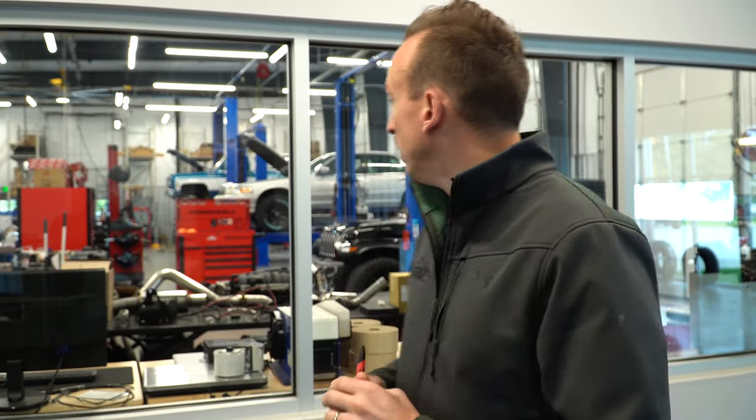So what we're gonna have to unfortunately do is set the upper control arm a little bit shorter than what would be ideal. And we'll just see what happens if it vibrates or not. It's just gonna be kind of a trial and error basis at this point. We've set the lower control arm so that the tire is centered in the wheel well. And that's just so that it doesn't eat up the plastics. Even still, I think we're gonna have to do some cutting and trimming from what we were looking at last night. But we'll fine tune that once we get it off the alignment rack.